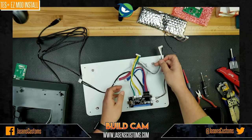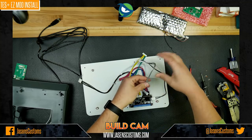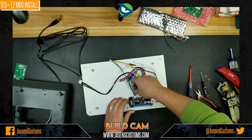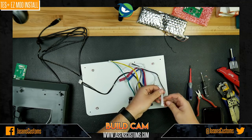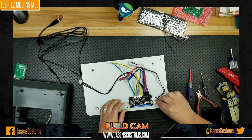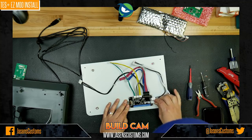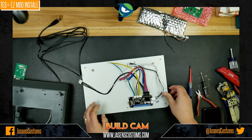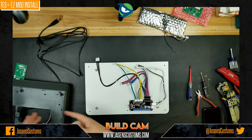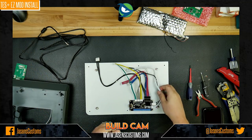Like so. Okay. Then the gray wire is your touchpad click stuff. So that is going to get installed here, like so. And finally, this white wire, which is never really going to be needed because I don't anticipate Brook to ever actually integrate all of the touchpad functions into the Universal Fighting Board, at least not yet. That goes there, and so voila. Now you've got this hydra of wires coming off of your Universal Fight Board that are going to come up into the case later. Okay, now, so that part is all done.